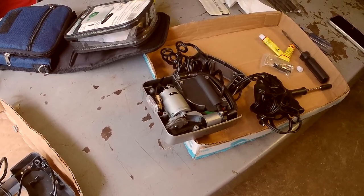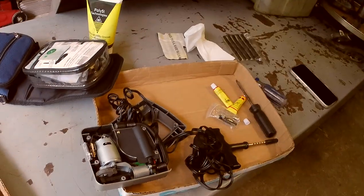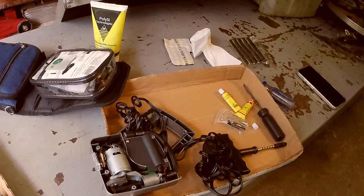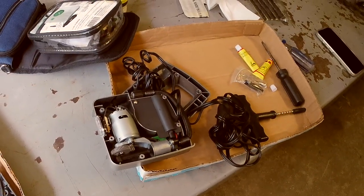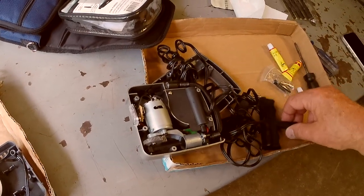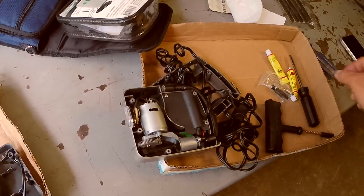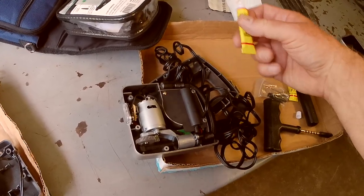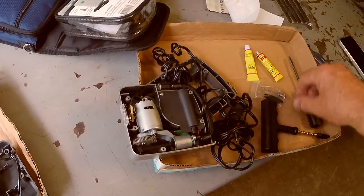after what happened. But for those of you who've never had a flat tire, there are two kinds of people when it comes to flat tires. Those who have had flats and those who will. And what you want to carry is a plug kit that consists of, sometimes they don't come with glue. I like the glue. That vulcanizes it, sets it up.